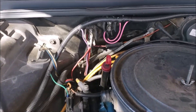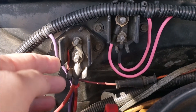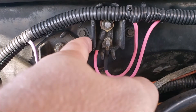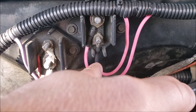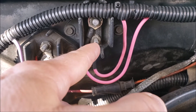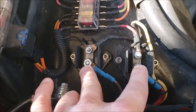If you're new to wiring — basically what I did: all these older carburetor trucks, even the big full-size square bodies, they always have one of these, and that's hot. What I did was collect some from the junkyard back in the 90s — hard to find them in the junkyard nowadays, but a lot of restore companies have them. I added one here and wired it back to my fuse box to give myself a nice thick gauge ignition hot. That'll be nice if I ever want to wire in a future fuel-injected wire harness or a FAST harness.